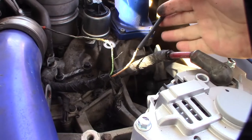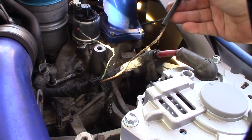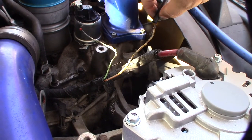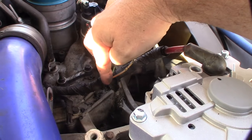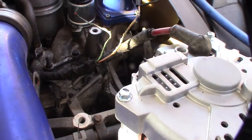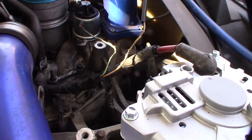I traced this wire all the way back down. I just put this on to protect it — it's actually a hot 12-volt right here. The one that's all melted — so I must have grounded out on something. I'm not sure what's up because the cover is melted all the way down. I took it down as far as I could. It's definitely not good.